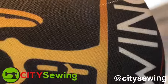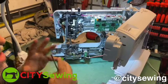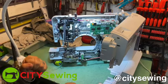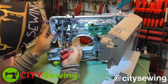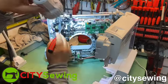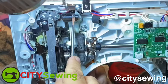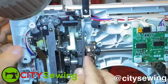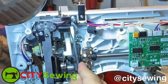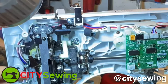If you look at the arrow here, now it disappears because the foot is down. But the problem is inside here — it's not a hard fix, it's just uncomfortable because you have to open up this machine. It has a lot of screws and if you don't do it right, you're going to break the machine. The problem this machine shows is when you lift the foot up, you get the E1 right away. There's a sensor — a laser right here — that's telling the machine that the machine is in the safe position, so you can't run it.